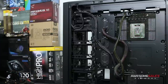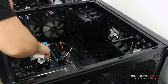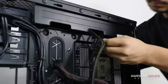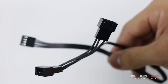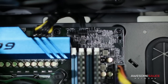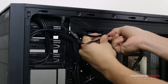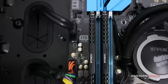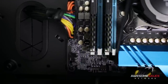Now is a good time to install the CPU cooler. If you're installing a closed-loop liquid cooler, make sure the fan cables are facing toward the back of the case and route them through the appropriate holes while they're still accessible. I connected the fan splitter that came with my CPU cooler to one of my motherboard CPU fan headers. After routing it through the top routing hole, I connected the two radiator fans and led the cables toward the front panel connectors. For the pump cable, I hid the excess length by routing it between two DIMM slots before connecting it to the CPU fan header.